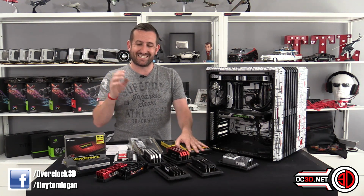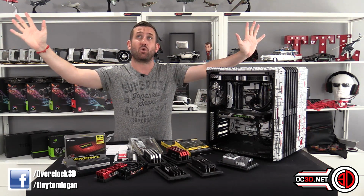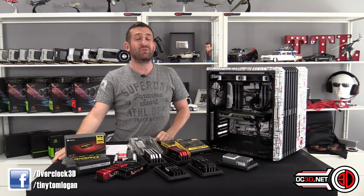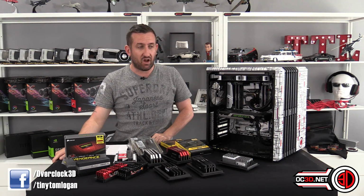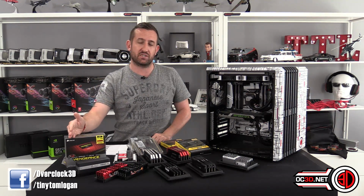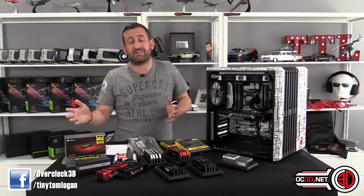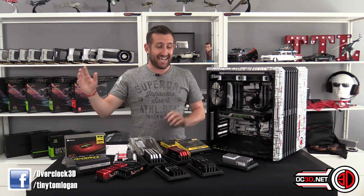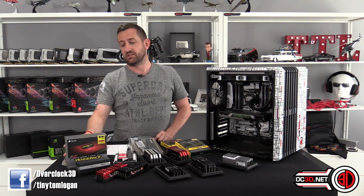So we got all that running. The system agent voltage, and this is a really big point: if you buy this, the system agent voltage has an uncanny knack of absolutely raging itself. Like I was getting 1.38 volts on the system agent voltage. I could get that down to 1.15 and it was still 100% stable. You should not have your system agent voltage that high unless you've got mammoth cooling. It's not actually that good for the CPU, so you always want to try and bring those things in. If you're a fit and forget kind of guy, it's going to naturally rage that to an unhealthy level.